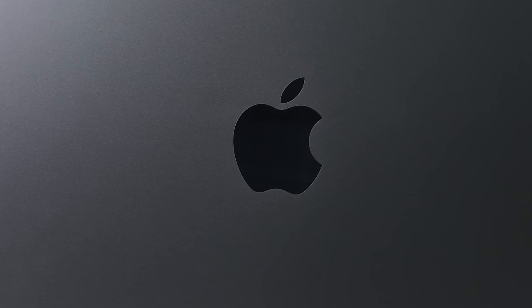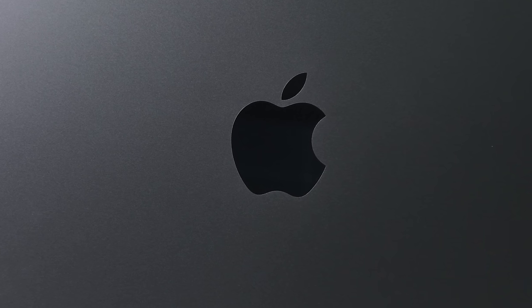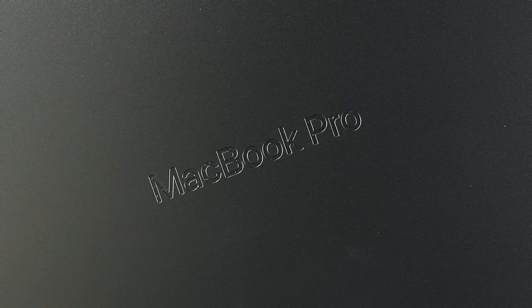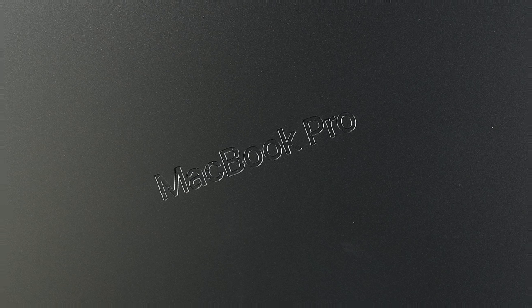But nothing close to black — the finish that resulted from this process was too glossy, which in turn makes it look more grey than black. In Apple's never-ending pursuit of aesthetic perfection, the company went a step further on the new MacBook Pro by etching the anodized bumps down to varying heights. This causes the visible light that hits the case to bounce off at different angles, effectively diffusing that light and creating a matte finish. The matte finish is key to keeping a case dyed black from appearing too grey.